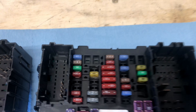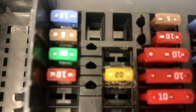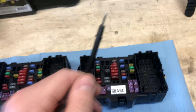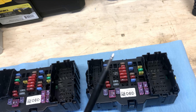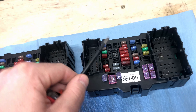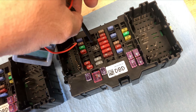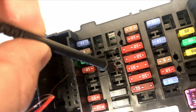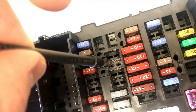The reason I'm making this video is because I goofed up. During a modification to the fuse box using a fuse tap, I messed up one of the slots. I totally messed up this slot on the fuse panel when I was testing for voltage using a multimeter to find a constant power and a switched power for my dash cam. The prong on this multimeter is a little bit too fat to actually get all the way in, and as a result, I accidentally forced it into the slot, unknowingly damaging the fuse box.